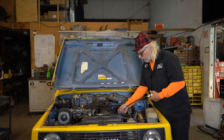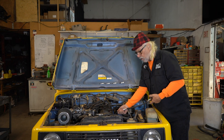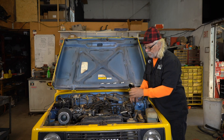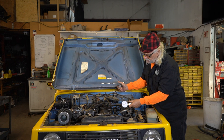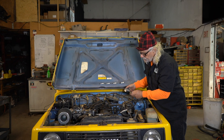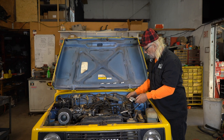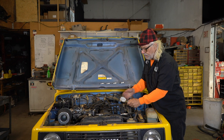We're going to go through and do all four cylinders and write them down. This is what's called a dry test — we just want to find out what it's doing first, and we do that dry. This last one here is only 135, and that's why we said we know this engine needs to be rebuilt. We're outside the variable of 10 PSI, and so that's why this engine is getting rebuilt.